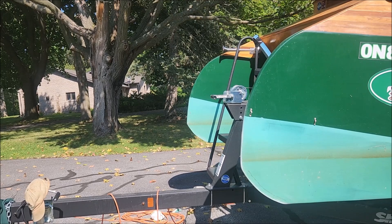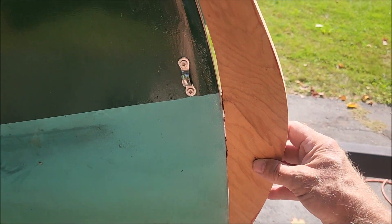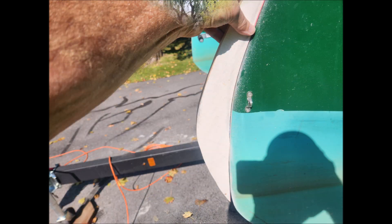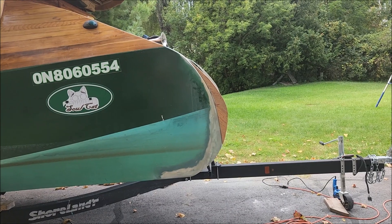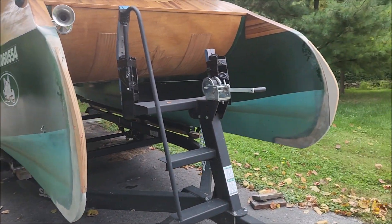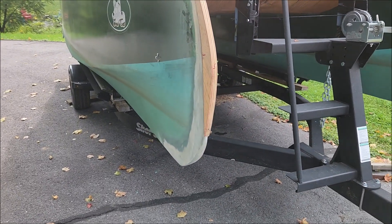Now I'll start the extension. This is a three-quarter inch piece of plywood that I've cut, and I'm now getting it fitted to the front — this is going to be my bow extension. I'll do one for the other side as well. I have the bow extensions tacked into place and I'm now going to epoxy them in. The next job will be to add lots of filler, build out the edges, and sand it so everything tapers correctly.